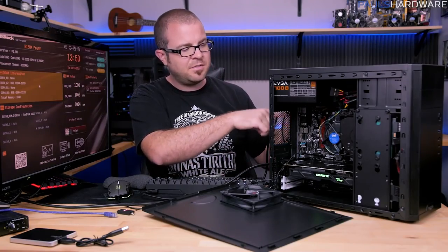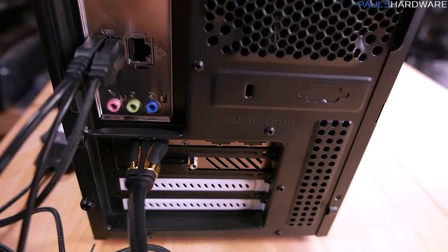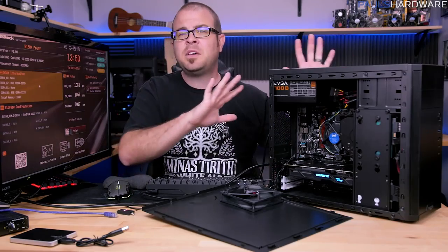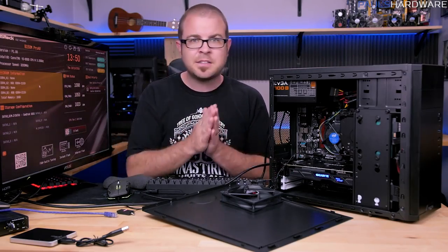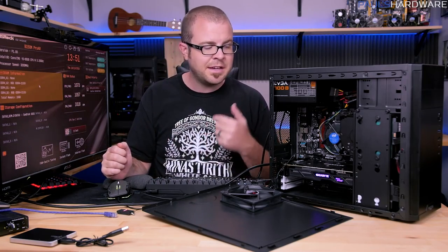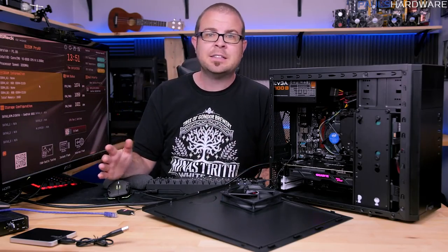You can check the video outs on the motherboard themselves, even though you're not trying to use them. And then, of course, the audio there, and possibly even the other display outs on the graphics card. Again, that's being completely thorough. I'll admit I don't usually do all that stuff, but it is something that would be good to check right off the bat, just in case you have a faulty port or something like that.